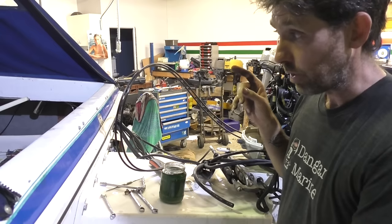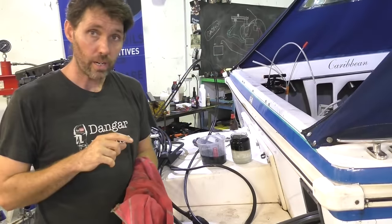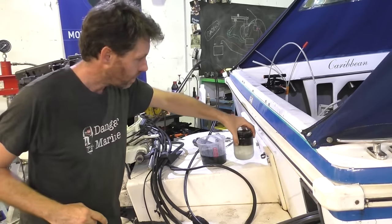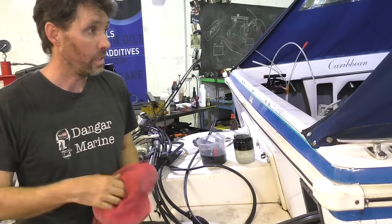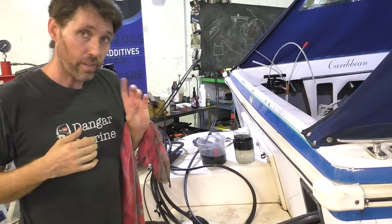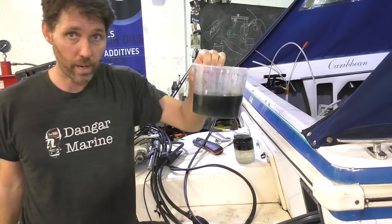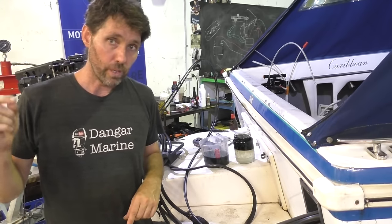While that settles, I'm going to go and have a look at the water separating fuel filter, drain it, and then we'll just keep pumping. These jars from the water separating fuel filter — this one is obviously just lots of really clear separated water. What's interesting is I realise now the fuel tank isn't as low as I thought; it's actually in the sides of the boat, so there's one below each gunnel. If I left the tap open for the fuel filter, fuel actually just gravity feeds through so you can let it keep running, which is kind of nice. The container got full so I put a new one under — which is now pretty much pure fuel. I'm now going back to pumping through the primer bulb to make sure there's only pure fuel in the whole fuel line.